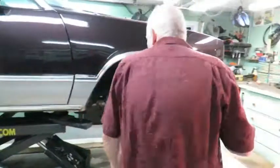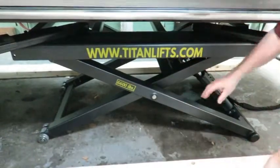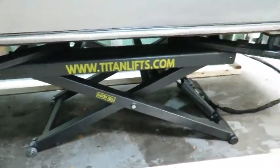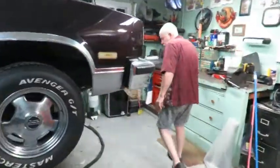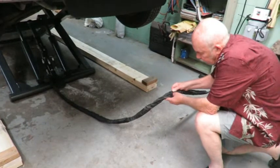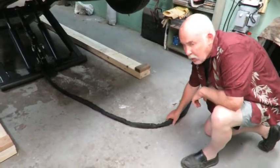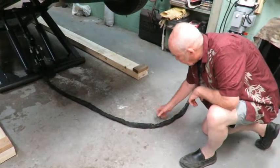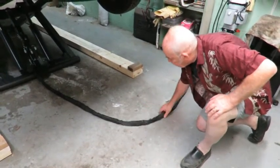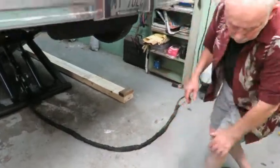This one is the 6,600-pound model, which is rare — most scissor lift hoists are rated at 6,000 pounds. Another thing I like is that the hydraulic line has a protective sheath on it, like you'd see on commercial vehicles or tractors. I don't know why other manufacturers don't do it, but Titan does. This hose has to lay on the ground, so it's going to be moving around and getting scuffed — that sheath is just common sense wear protection.